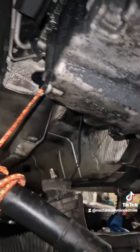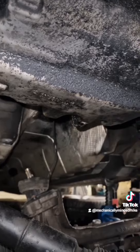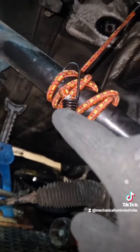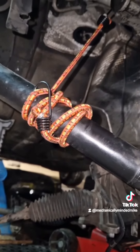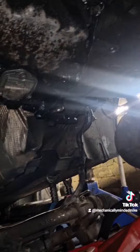The steering rack and driveshafts were out because I was doing the gearbox, but one of the driveshafts was actually stuck in the hub so I just left it hooked up there. The rack, front subframe, the exhaust all came off. I'd assume at some point in its life it already had a new back box, hence why the cup was there, so when it came to put it back together it was just sleeved together.